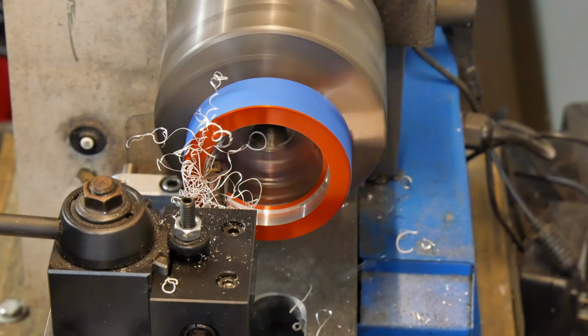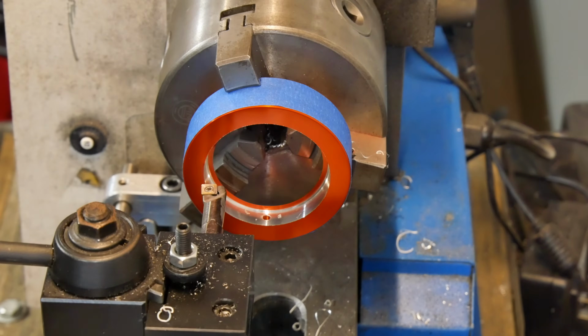I only cut the Bellmouth to 54 millimeters, which isn't actually big enough to fit over the lip on the carburetor, because I planned to cut the lip off and make it a better fit instead of having the whole adapter 1 millimeter oversized for most of the mounting surface.